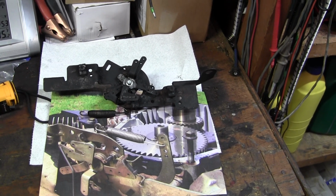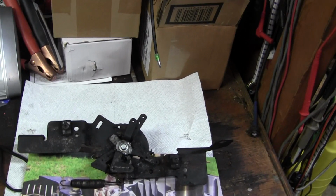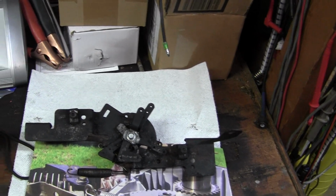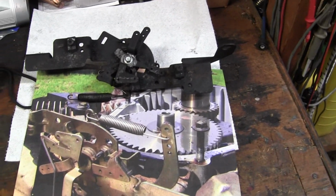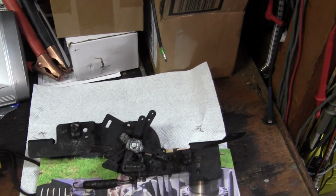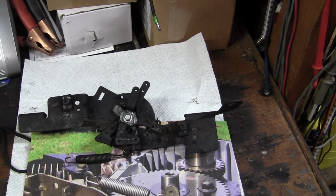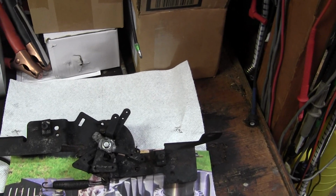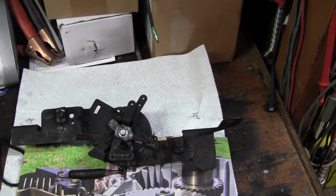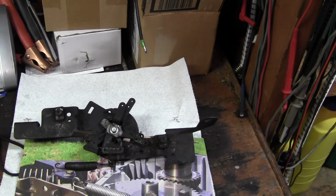The only bad part about this engine is it had some bad head gaskets back in the day. That has been replaced by Kohler with new parts that work better in later releases since 2003. Besides the head gaskets failing, on the vertical shaft engine, the lower seal likes to pop out. When that seal fails, it saturates the area with oil and can cause a fire if you're not careful.